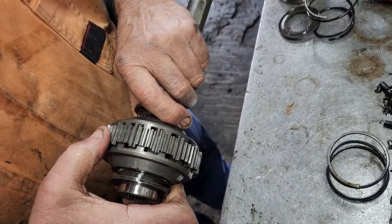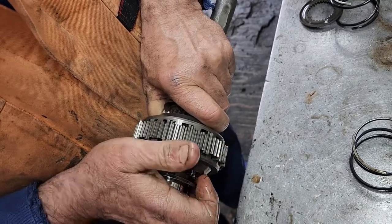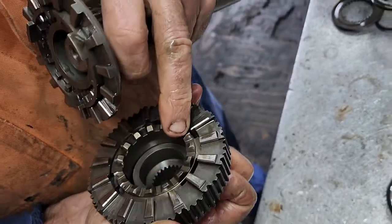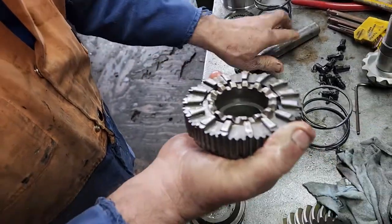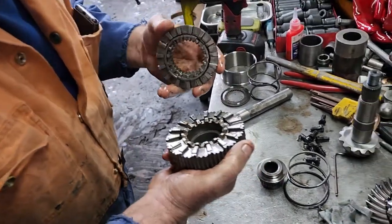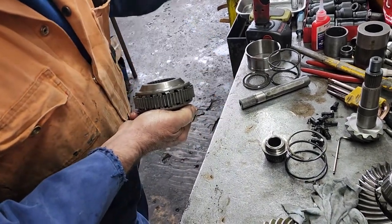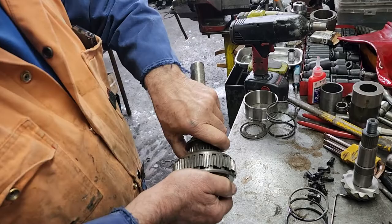It's being driven that way because the clearances are at the back. As soon as one wants to go faster, those feet lift up, riding over the cam, come out of these slots and sit up on top of that undercut. Then as soon as it slows down, of course it snaps back in by those big coil springs. This is when you're going around the corner and the wheels want to differentiate — the one that wants to go faster disengages. On a right-hand turn the left-hand wheel is going faster, so that would be the one disengaging.